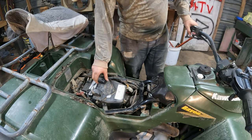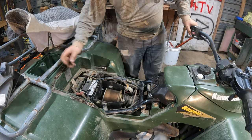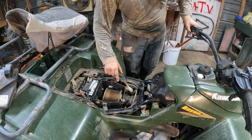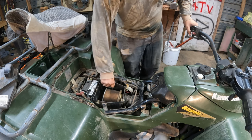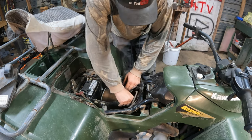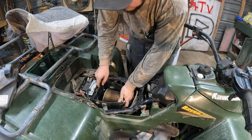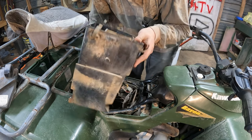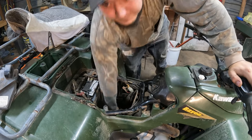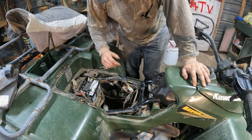The first thing we're gonna do is remove the air box. Normally there's two 10-millimeter screws, one right here and one right there, and then a third one down here holding on the voltage regulator — looks like they already pulled them out. Pop this little boot off, it's got two clamps you loosen with a Phillips screwdriver. Check your air filter — this one's filter element is good but the plastic is in bad shape.